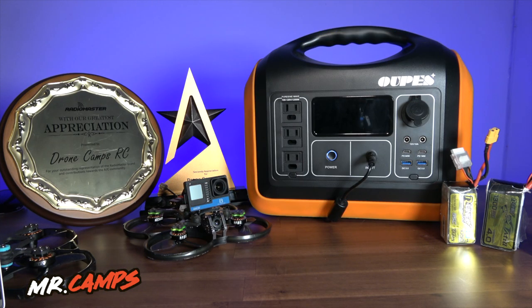You can run a power tool on this, but it has voltage protection regulation and it's going to turn itself off at about 1,600 watts. So if you get over around 1,500 watts, it'll go into a power safe mode and shut off. I was able to run a power tool for about five minutes at 1,200 watts safely without it cutting off. But when I reached around 1,400 watts, it only lasted a few seconds before it turned itself off.